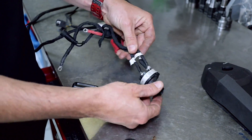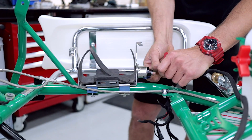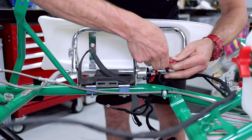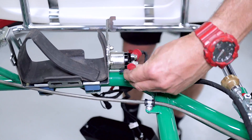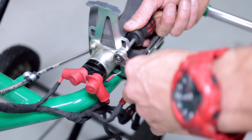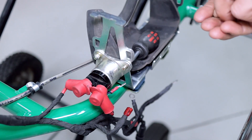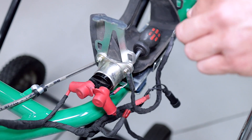With the trusty Phillips head screwdriver we're just going to do those screws up — screw the harness to the terminals of the rotary switch. Now we've done that, we're going to install the rotary switch into the battery bracket. Now we've got that done, we're going to put the harness onto those two terminals of the solenoid. Pull the rubber caps back, do up the two 10mm nuts and you're good to go. Don't forget to put this little guy on — you take that off, this little guy lives on there, then this goes back on and we're good to go.